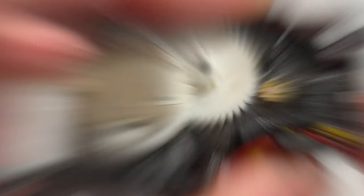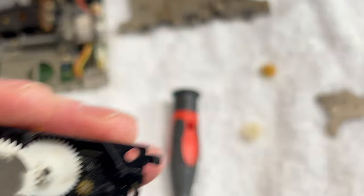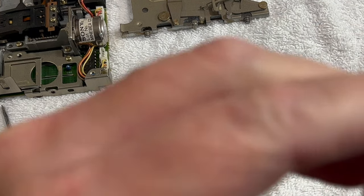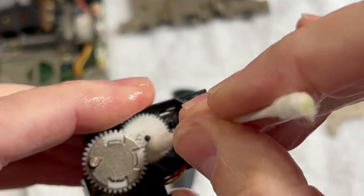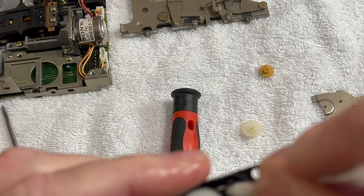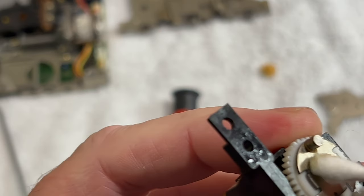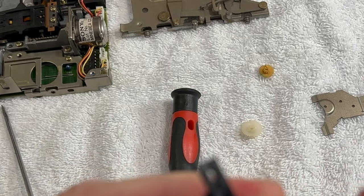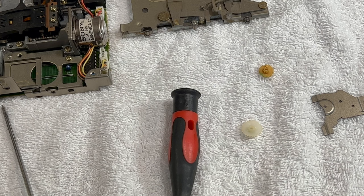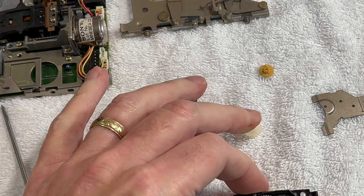The little metal gear is fine — there's just a bunch of plastic that was all around it from the old gear and the dried lithium grease. We're going to clean that up. We'll get a little isopropyl alcohol and clean this up in there, getting all that junk out of there and making sure we get all that fuzz out of the little cam there. I'm going to put a little light oil on that.